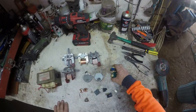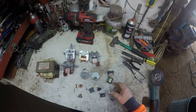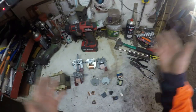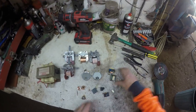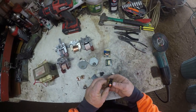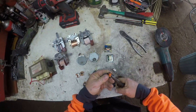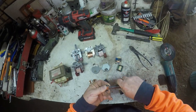Getting down to these little transformers - they're on circuit boards. You get better value for your copper if you take it off, especially if you're doing a wash machine or microwave. The circuit boards aren't worth anything as a circuit board - they're basically classed as scrap shred. Your best bet is to actually take your little transformers off and get your copper off, because there's not much weight in it. There may be a couple of copper contacts. I'll pull one apart - there's already one apart here and there's copper in that.